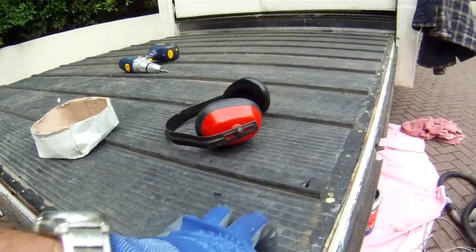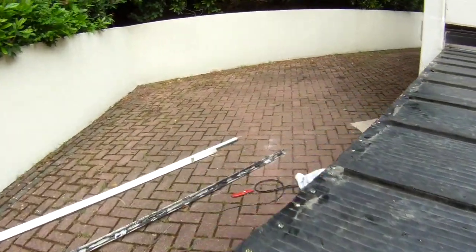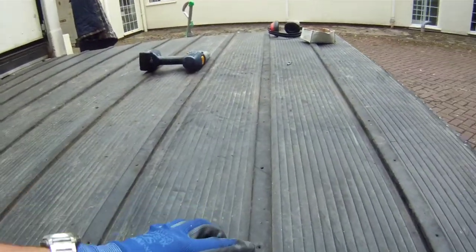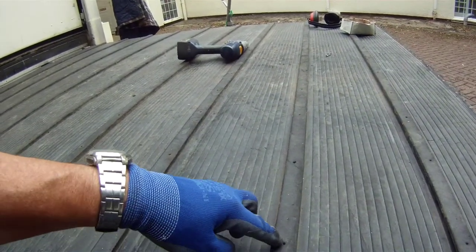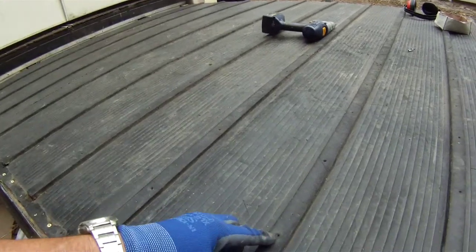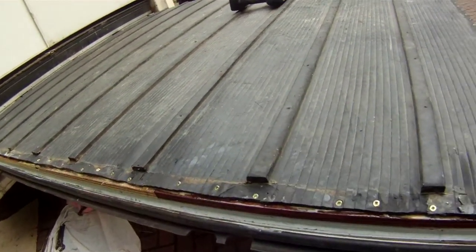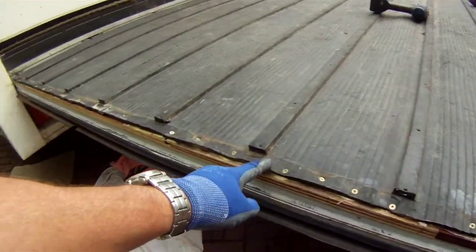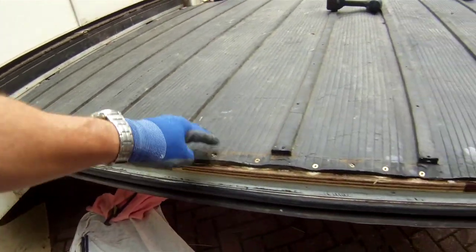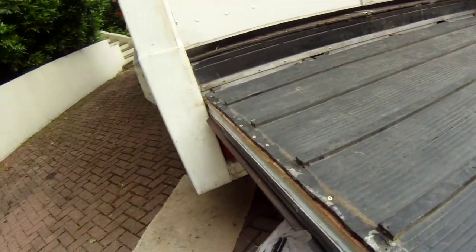And you see I've applied screws also to screw down the edge of the rubber, and also applied the right length screws at regular intervals on these rubber strips. You can see the screw head has actually sunk down into the rubber and therefore becomes invisible. Keep screwing down around the edge till all this edge is kept down, not leaving any gaps. Hopefully then it's a watertight seal between the rubber and the plywood.